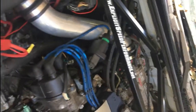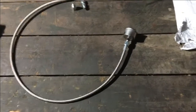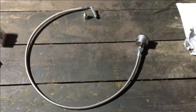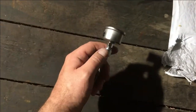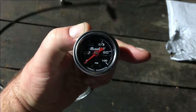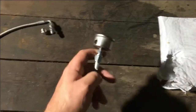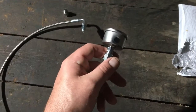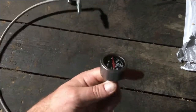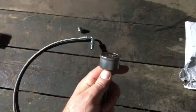Under the hood I decided to finally delete EGR, and now I have a perfectly functional OBD1 EGR for sale. I'm going to redo the seals for the fuel inlet banjo. My oil pressure gauge and feed line — 1/8 MPT — came in, and I put them on here. It's liquid-filled so it doesn't shake so much going around corners. I thought it was going to come with mounting gear but it doesn't, unfortunately. I'm trying to cut a metal plate that would just fit inside, but I'm going to have to do a little more than that to get this thing to sit in one spot.